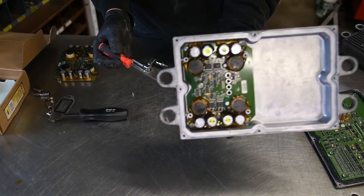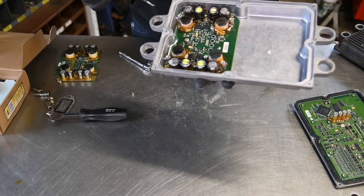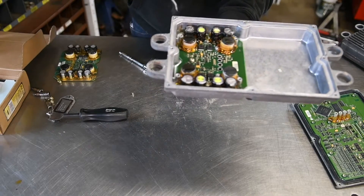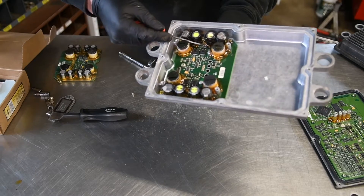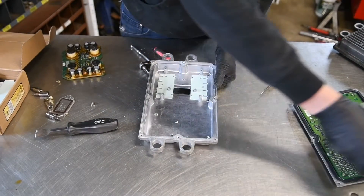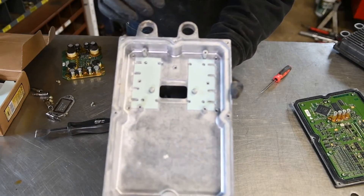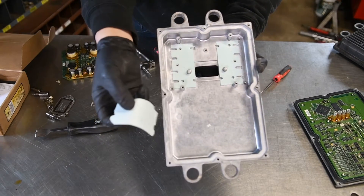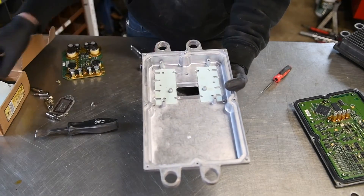Now you can see the power supply. Take the two little heat covers off. There are seven bolts that hold this power board into the shell. The biggest pain on these is they put resin around all the capacitors and the resin drips into the bolts — some of them you have to get in with a sharp pick and really pick out all that resin just to get a Torx bit into the bolt. Once you get that board out, you're going to have to peel off the heat transfer tape — new stuff comes with the kit. Peel it all off, make sure you get all of it, then reinstall with the new tape.